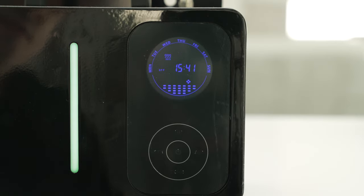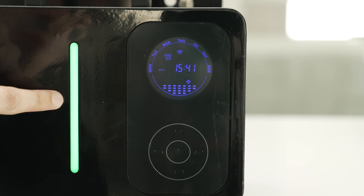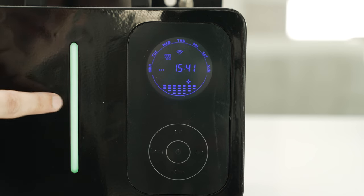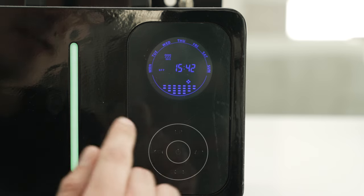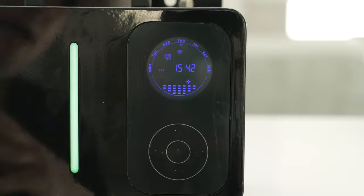The reason I asked you to set those volumes and levels to 500 milliliters is because they affect this indicator light. If this light is shining green, that's letting you know you have more than 50% oil in your tank. If it's blue, you currently have less than 50%. If you see it flashing red, that means it's nearly empty or empty. Every time you load a new bottle and set both volume and level back to 500, this will turn back to green, showing the exact amount of oil in your bottle.